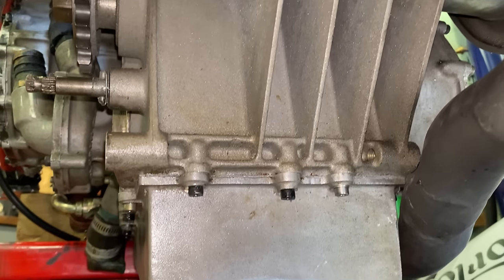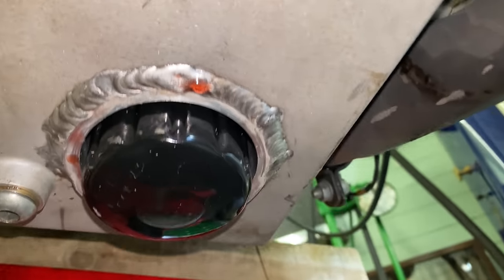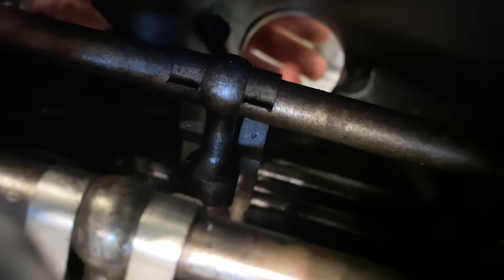There's substantial triangulation from the swinging arm spindle down to the back of the engine for stiffness, and underneath is a conventional screw-on oil filter. There are two large holes cut in the frame underneath the headstock spindle to allow air into the airbox — this is unfiltered.